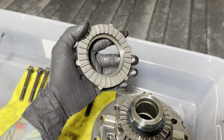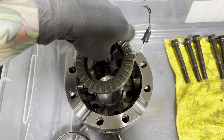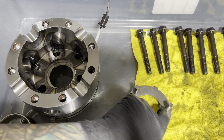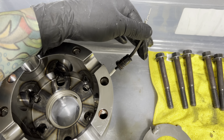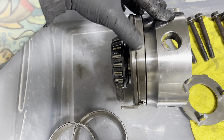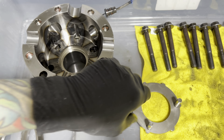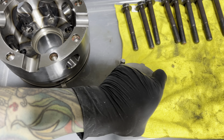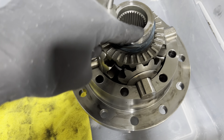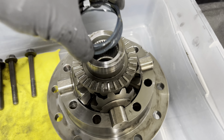You've got this gear here, which sits inside of this part of the case. You've got a handful of holes, so you just have to spin it and line it up, and it'll drop into those holes. When you engage it, there's your little 12-volt part that comes in. You're engaging the electromagnet, and it's going to put pressure on this setup, which in turn is going to lock into this gear here.